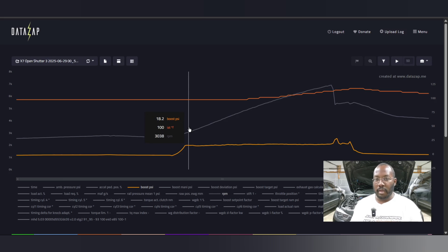I ended up reverting back to letting the OEM functionality for the shutters take over, largely because I do a lot of road trips and daily driving in a very big heavy car — letting the shutters function normally helps with efficiency, engine warm-up, and gas mileage. But if I were going to a race and wanted the absolute best performance, I would definitely lock those shutters open for maximum cooling.